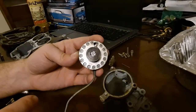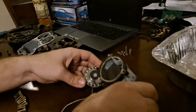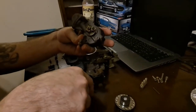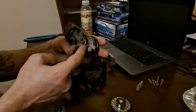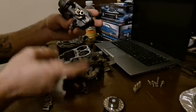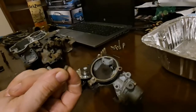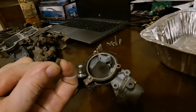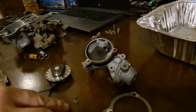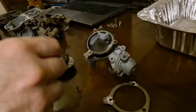When you get in the car when it's first cold and you set the choke by pushing the throttle pedal once or twice, what you're doing when you go full throttle is you're releasing the little cam mechanism right here. It allows the choke to go completely closed. Then as that warms up, this opens in a stepped amount on this screw until it's back to a slow idle and the choke's wide open. If you lose this, you're kind of screwed unless your carburetor kit came with one — mine did. A lot of people will get a new choke coil, lose that, stick it back on, and then the choke doesn't work or only works about halfway. And they get mad and it ends up wired open like mine was.